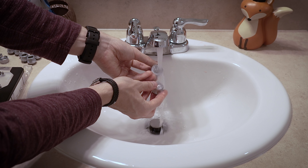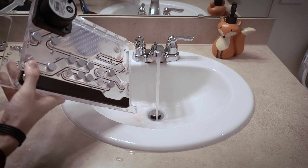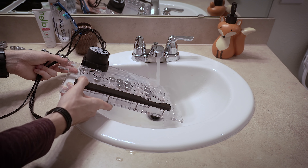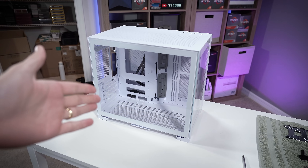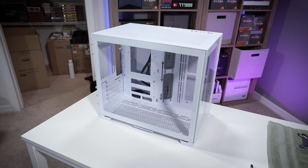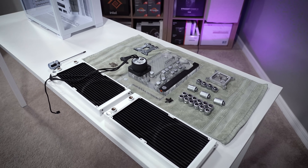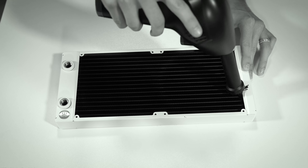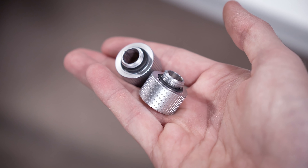Now the best way to do this is to completely disassemble the block, get down to the channels, and start scrubbing those with a toothbrush or something just to get all the potentially clogged gunk out of there. But it looks pretty good here. I'm surprised that the coolant held up this well — pretty impressive for opaque stuff from EK. This block looks almost brand new already, just with water. Really good stuff. These fittings all need to be taken care of, the extensions too. The distro is going to take a while because it is so large and there are so many channels. After about 30 more minutes of that, we have a clean case. It is now just bare and empty, like it would look if you pulled it out of the box for the first time. Here is most of that gear apart from the tubes, which I tossed because we won't need these for whatever custom loop we assemble later on. The radiator fin stacks still need to be scrubbed a bit — I will tackle that after the fact — but the insides and the channels have been flushed. The blocks look a lot better and we've reassembled each of these fittings. They are ready to go for a new build.